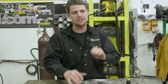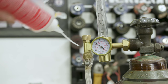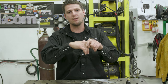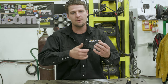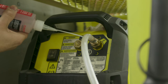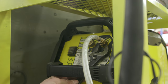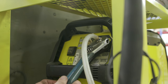Make sure the threads on the hose brass connection are not damaged and everything's seating nice. Take a little leak detectant and squirt it over there. Then check the crimp hose on the hose bib or fitting — make sure that's crimped nice and tight. Make sure the hose clamp is not over-tightened; when you over-tighten it, it digs into the rubber. Also check the machine seat and hose fitting on the back of the machine for nicks. Connect them nice and snug — you don't want to over-tighten them.